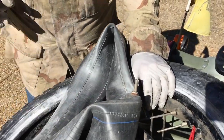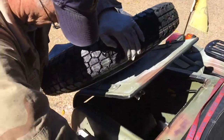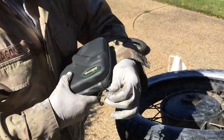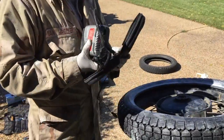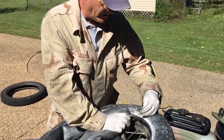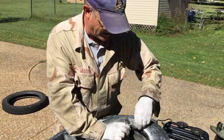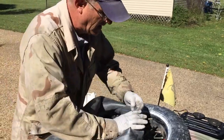If you don't have one of these, buy it — it's made by Slime, it's an air compressor, and it's worth its weight in gold. Just carry it with you. I was wondering if there's a way to put the stem valve back in and then insert the compressor, but you can't because rotating the hose rotates the stem and you can't get air in. So that doesn't work.